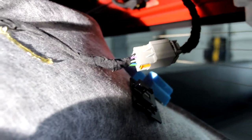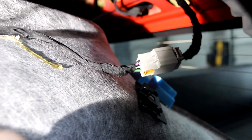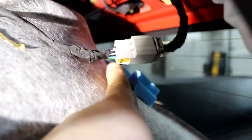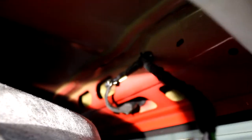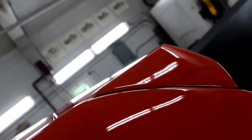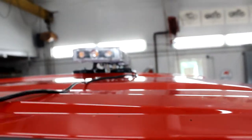So this is the connector hooked back up — again it was the green with the blue tracer. I discovered that it's not dead-ended here; it passes all the way through and it's heading up towards that third brake light. So at this point we are going to pull off the fiberglass piece with the third brake light, hoping we're going to find that wire up there inside of it so we can wire in the light the customer bought.